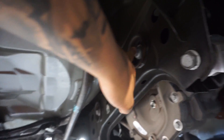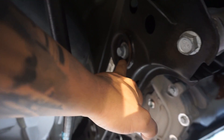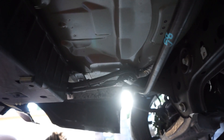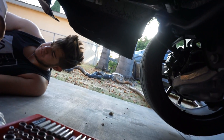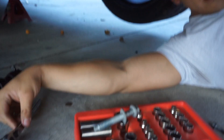Alright guys, as of right now we're just loosening up the rear subframe bolts to give us more clearance. You just want to loosen these up a little bit so the subframe itself will drop, giving us access to the differential bolt. We're going to do one at a time — the instructions specify to do one at a time. We'll remove the bolt and set up with the washer, then this spacer that goes inside, then a washer on the back with some grease.